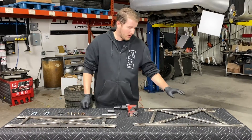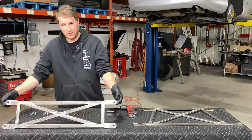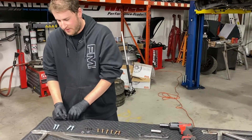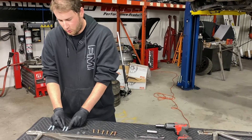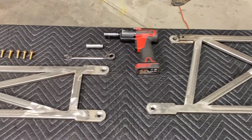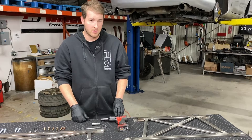Let's go over the components of the kit. Over here we have your front brace, a little bit larger, and over here we have the rear brace. Here's the assortment of hardware you're going to use to install it. There are longer 35mm bolts for installation on an NA and shorter 30mm bolts for installation on an NB, so you will have a couple bolts left over. As far as tools, you're going to need a 13 and 14mm socket, and it also helps to have a 14mm wrench.